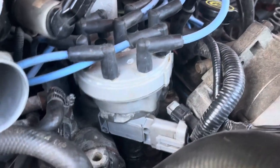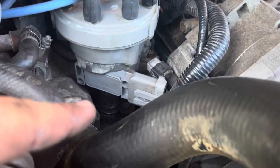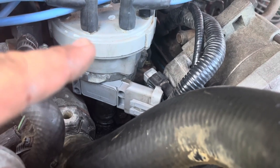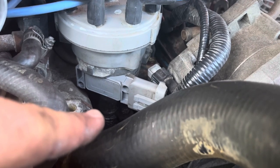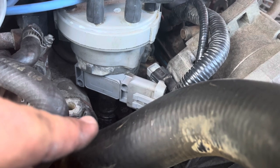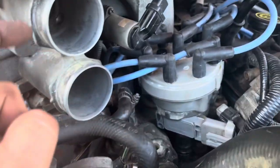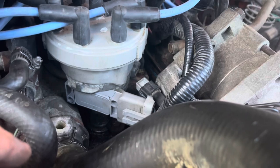Four or five tries to get that gear back into the block properly so that the rotor matched up and the line matched up. You can see right down — the top right in front of my finger, black, black — everything lines up. Got the plug back in, just got to put the intake hoses back on that I pulled out of the way. New Motorcraft module in it — here we go.